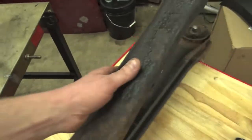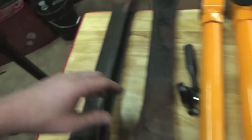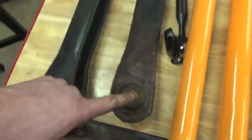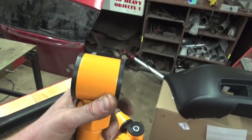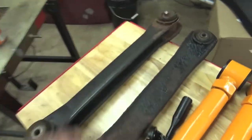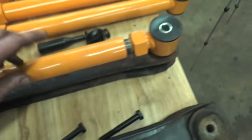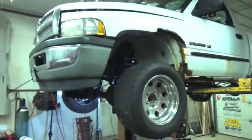Our upper control arm is a little shorter than our lower control arm, as you can see right there. So these two are our new lower control arms and these two are new upper control arms. We're going to add probably a quarter inch to both of them just to push that wheel forward a tiny bit more. The way you adjust these is they actually just spin out — lefty loosey comes out and then you lock it down with the jam nut right here. So I'm going to line these up on the bench with bolts and then add a quarter inch to each the upper and the lower. You can see in that hole we got that one perfectly centered and this one a little bit far forward — that's what we want. We'll match this one up to the other upper control arm to get them perfectly the same size, and then lock these jam nuts down when it's on the truck to hold it in place.